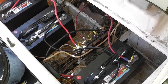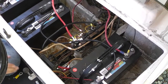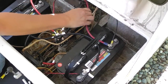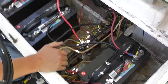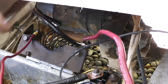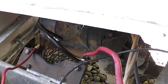We've got something going on, but it's not going anywhere. I smell heat — something's getting warm. This is where I should have bought that thermal imager from Harbor Freight with the laser on it. I smell something hot — something's very hot. I smell cooking. All the wires are not hot. I think it's this — yes, this is extremely hot. I'm going to go ahead and disconnect it. I don't know if it's cooling down or still cooking, so I'm going to pull the battery cable.